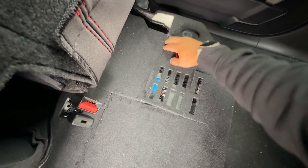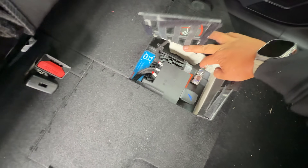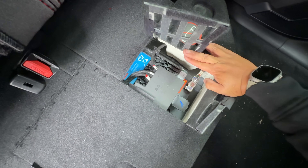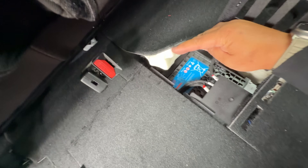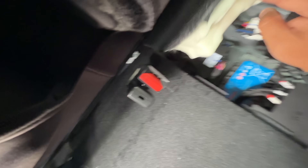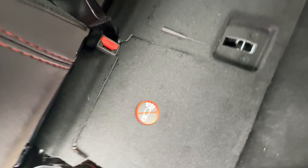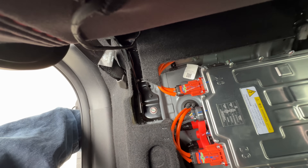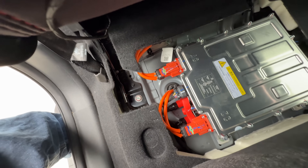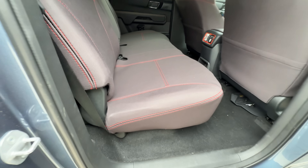This is basically where the 12-volt battery lays — it sits under here. Here we go — so it's a 14 amp-hour battery. It does say 60 amps draw, but 60 amps still isn't a lot. They call it the LFP starter battery. You can't really run anything off this system — I wouldn't be connecting stuff onto the terminals and utilizing it. Also, someone asked about dust ingress at 4,500 kilometers — it's clean inside. I've never cleaned under here, but that's where the high-voltage stuff runs in, and yeah, it's clean under there.